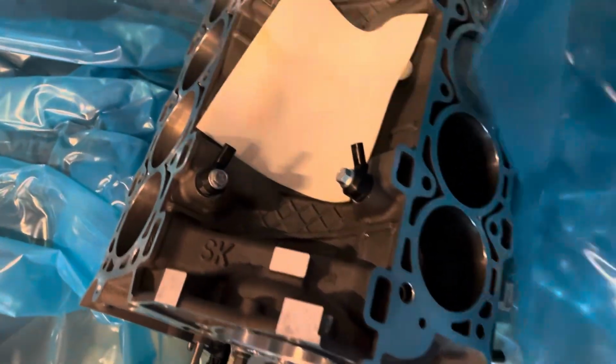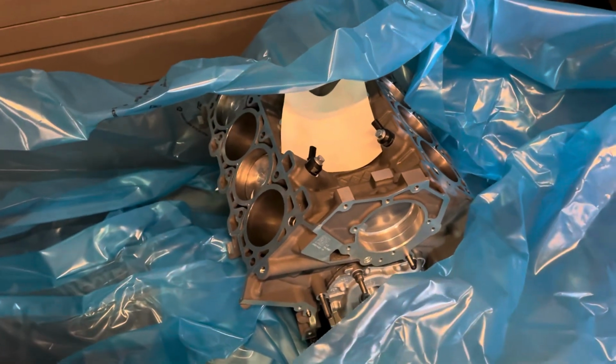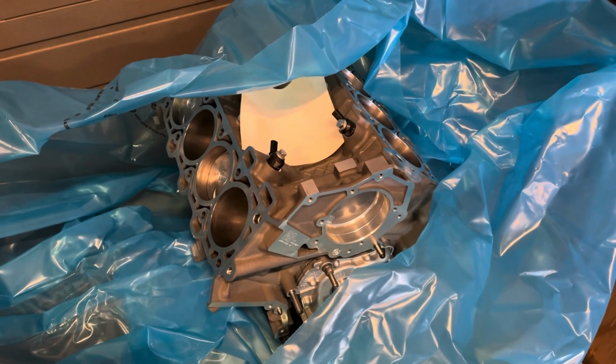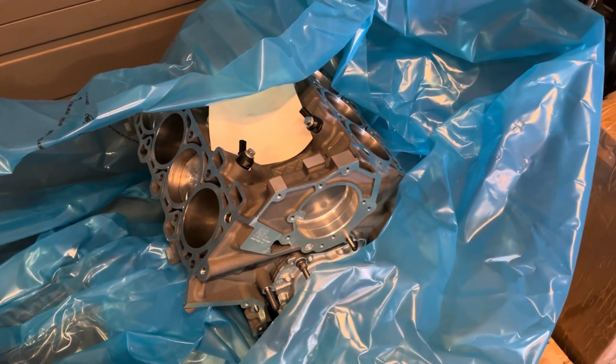So yeah, under this VCT bag, we got a brand new Gen 3 short block from Ford not too long ago, and this build is for gentleman Grant from Spectral Racing out in Florida, who has commissioned me to build this thing. And why are we doing a 3-2-1 build? It is because this is going in his 2008 road race car, Mustang GT. So not only is he going to do a 3-2-1 build so that we can use the Gen 1 ECU, he's going to use our harness so that it's all plug and play, nice and simple for him.